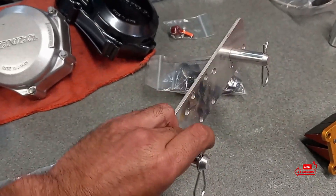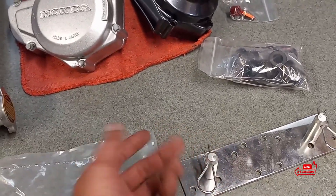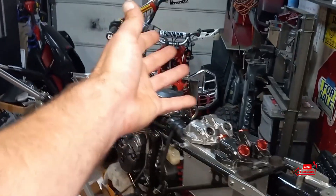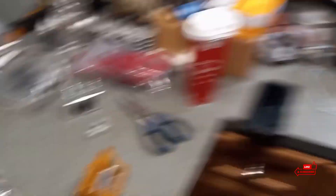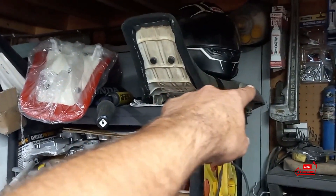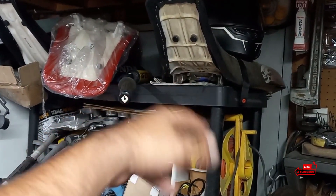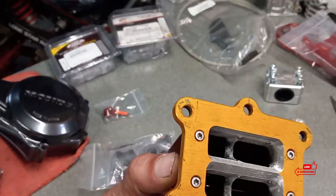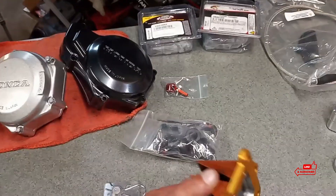From BVC Trikes, I have the seat latch that uses the hitch pins — trailer pins, cotter pins, whatever you want to call them. This deletes the latch that goes on the seat. Sometimes the 250R rear seat will come loose. This one hasn't, but I'm going to go ahead and upgrade anyway. I also have a whole other 250R seat up there — I'm probably going to recover that one and leave the factory cover on the other one and put it to the side for now. I have a used ESR reed block — this thing is really sweet. This is going to go on that bike. That 330 actually has a factory reed setup in it, so I'm going to get a little bit more performance out of it. I'm going to do that when I pull the carb off and rejet it.